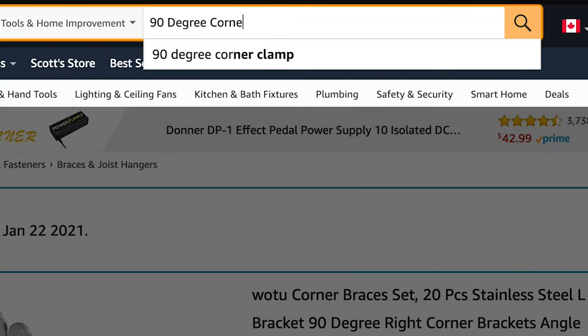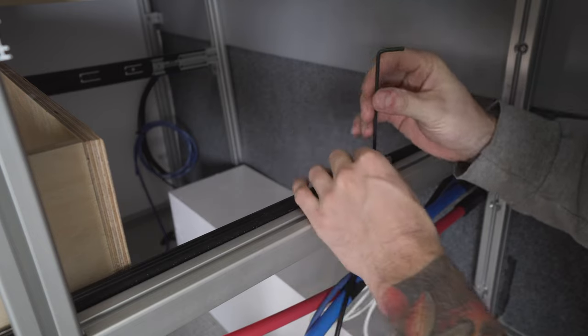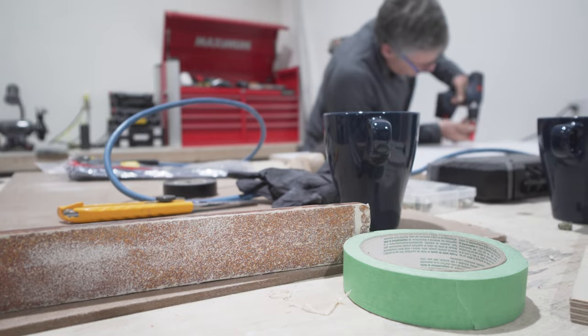The first step is to just get the panels test fitted in place. I would make the panel and clamp it on the face it was getting fastened to. Once it was clamped in place, I took my 90-degree brackets — just got these off Amazon, link in the description — and placed the angle brackets onto the 8020 where I wanted the fastener to be. Then using a spring-loaded punch, I could mark the back of my panel where I needed the threaded insert to go so everything would line up. I'd get all the angle brackets in, clamp the piece in place, punch out where I needed to put the threaded inserts into the panel. Once you took the panel off, you could see the indents the punch made, and it was time to drill those out using a regular wood drill bit so I could thread in the threaded insert.